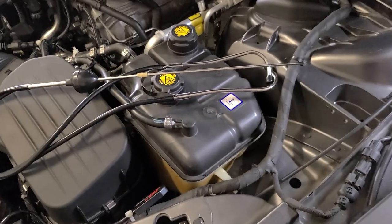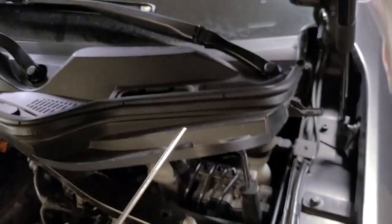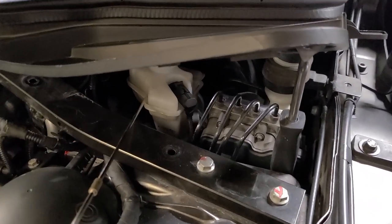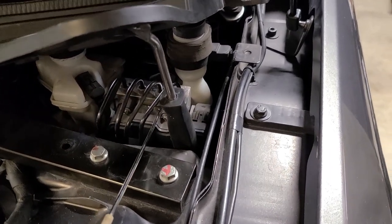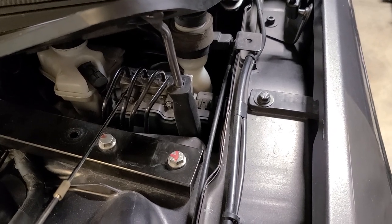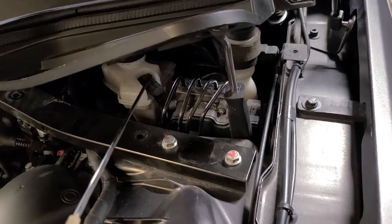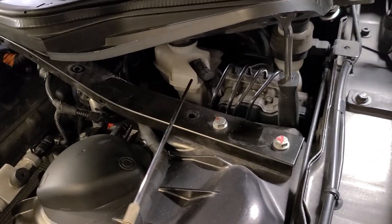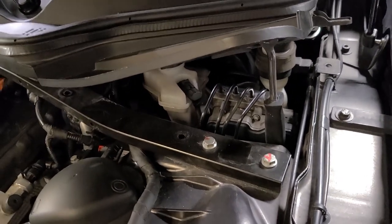So let me show you what I did. I got myself a mechanic's stethoscope. Here underneath the windshield water tray we have the ABS hydraulic unit and the master cylinder. I had my son apply constant, steady, hard pressure on the brake and I listened — placed the probe on different areas of the ABS hydraulic unit. Other than the initial surge, which is normal, I didn't hear anything going on while the pedal was going down. So I tried the master cylinder, placed it in a couple of areas, and lo and behold, I heard something going on after the initial surge.